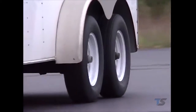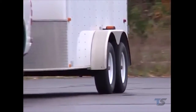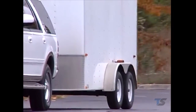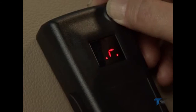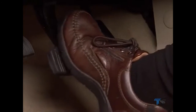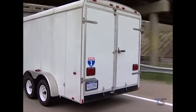The reverse feature will disable the boost for a short period of time. This is intended for use when there is no need for aggressive braking, such as backing up. To enable this feature, hold the boost button while pressing the vehicle's brake pedal until dot-R-dot is displayed, then release both the boost button and vehicle brake pedal. This will temporarily turn the boost off. The boost will automatically restore itself to the previously set level after three minutes of no braking activity, or by pressing the boost button.